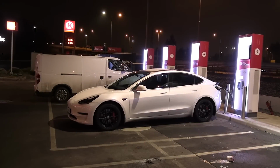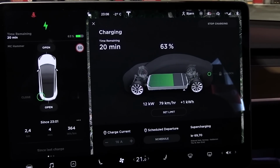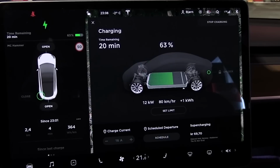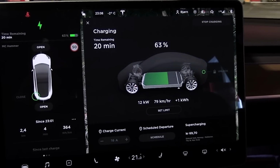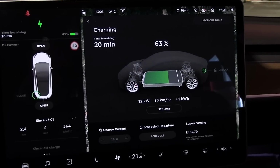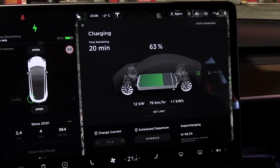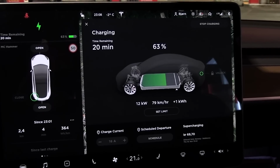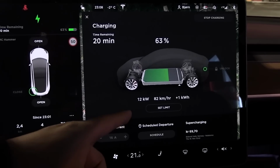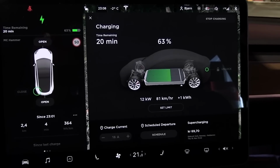We are now outside of Circle K at the 150 kilowatt fast charger. And you see, we are getting only 12 kilowatts. So actually, outside my home, I didn't charge because there wasn't enough power. So I think I said it wrong there. If you have fast enough AC charging at home, you will probably get some power, but the battery will also try to heat up. But over here, we're getting 12, 13 kilowatts because that's what the BMS will allow you